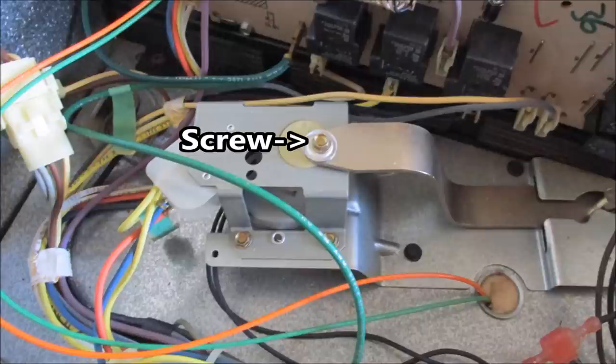The problem is you can't open the door to put a pizza in or take one out unless you bypass the lock itself. The circuitry and the relays know the lock motor is engaged because there's a little switch on it that tells it. But if you disengage the little arm — the little hook — the lock motor will just move back and forth and it doesn't know or care. You can actually take the little screw out of the shaft on the motor. It's a little gear motor that moves real slow. Take the little shaft off, pull that lock arm up, and wire it to stay unlocked all the time. Very important — pause and read this.